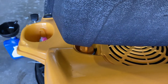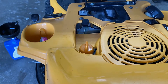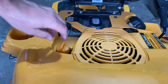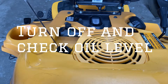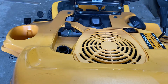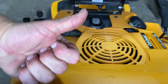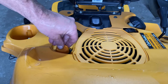I bought the oil filter, air filter, fuel filter, and spark plug as a kit together online — about 20 bucks. Two quarts of synthetic blend is about 10 to 11 bucks, so a little over 30 dollars total for an oil change. The dipstick has arrows, lines, or holes for add and full — right now I'm up to the top hole which means I'm full, good to go. Put that back in.